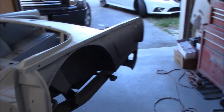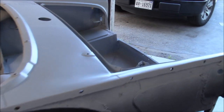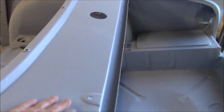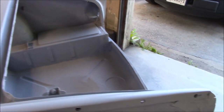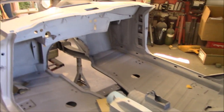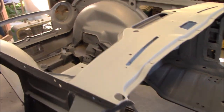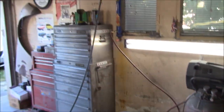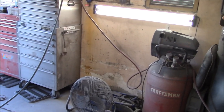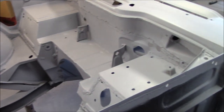The rear bumper will be going back on as a stock bumper - nothing too crazy back there. I'm happy with the way the engine bay has turned out. Next steps are to get out here with a soft block and some 400 grit and start smoothing this out - we'll do 400 dry and 600 wet to get it smooth and ready for paint, hopefully within the next few days. That's weather dependent, and I also need to sort out my filtering system, get more desiccant, and get my refrigerated dryer hooked up properly.